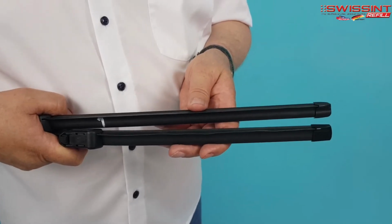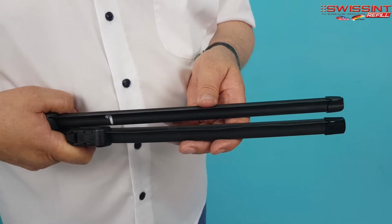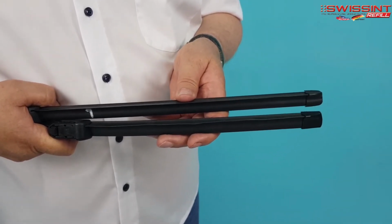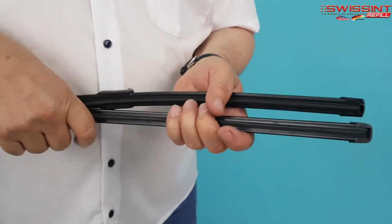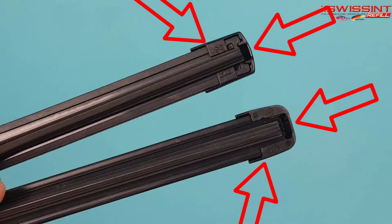What does this entirely mean? Look at the aero wipers from the back. Then you will see the cover caps and how to remove them. In the present example, it may be a Bosch, Trico, Champion or a Mitsuba wiper, because viewed from the top, they all look the same. On the back, you can immediately see what wiper it is.